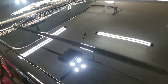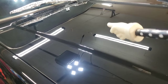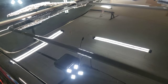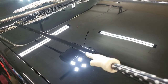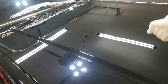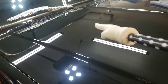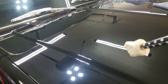Like I say, Joe, I don't know if you were on earlier, but this clear coat, even though it's very thick, up about 8 to 10 mils of paint on here, Joe, that's a lot of paint. But whoever mixed this clear coat, and I had a paint guy come by and look at this for me, I said, why is this clear coat so soft? I mean, it even feels soft when you feel it with your hand, Joe. He said, whoever did this did not put enough hardener in the clear coat, in his opinion. That's why it's so soft.